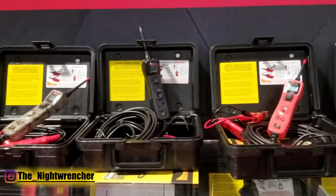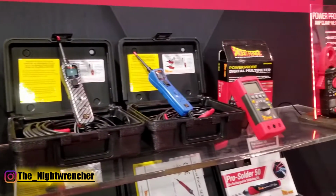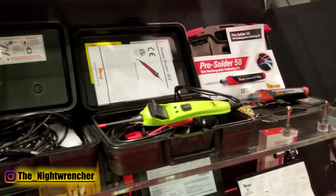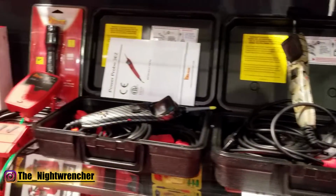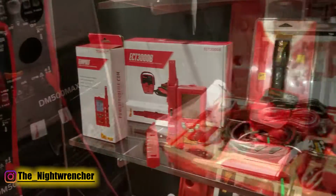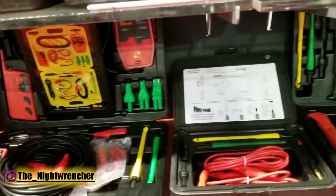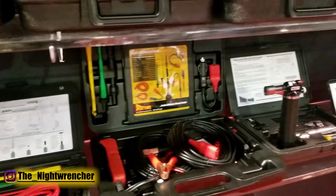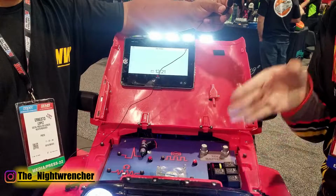In your words, would you say that this is probably a little bit more useful than a multimeter? Yes, a multimeter will give you readings, but you're not going to be able to power up components, which I kind of call dynamic testing. You're actually operating the component. Testing with an ohm meter might tell you if you have an open or something, but it's not going to tell you things like if it's sticking, dragging, heating up under use, which actually dynamically powering the device will.